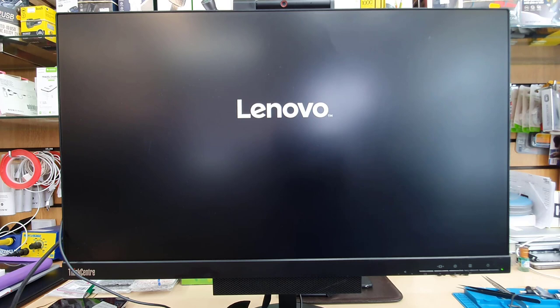So every time it restarts, if it goes back to the beginning of the Windows setup, don't worry, just cancel the setup the way I did. And then when it restarts, keep pressing F12 so you can choose the temporary boot option, the internal SSD or hard drive, until it finishes. Once the setup is finished, it will be absolutely fine. You can take out the USB and the computer will start up from the internal storage, hard drive or SSD.